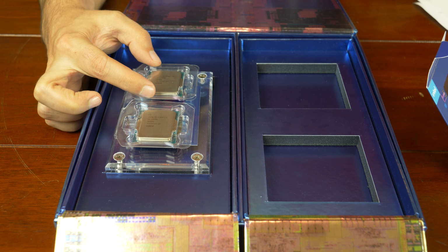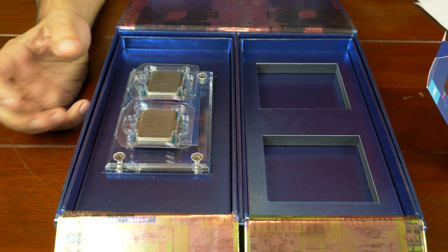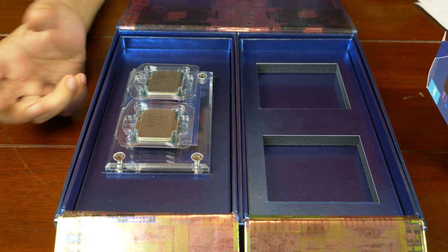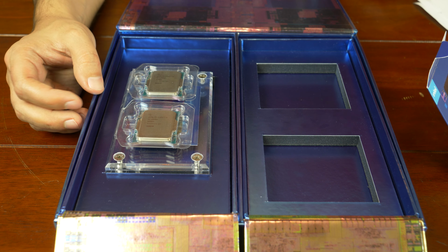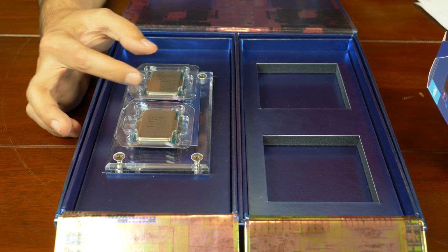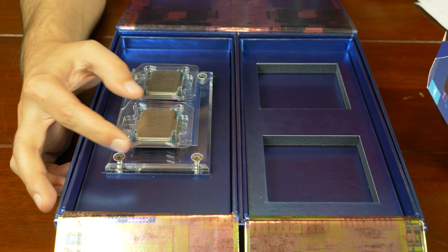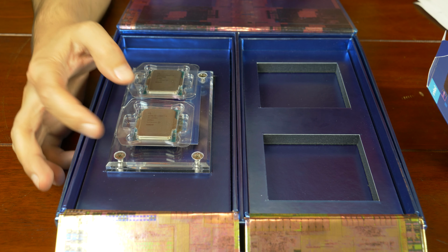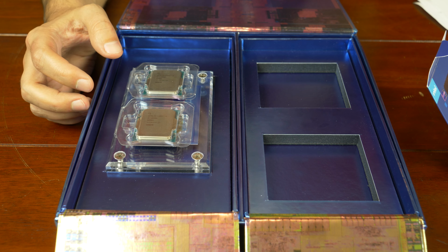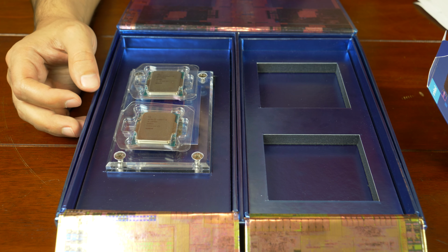Anyways, we have higher cache sizes. Starting here, we have 36 megabytes of Smart Cache, which is basically L3 cache with enhanced prefetchers, and the cache is smarter. Anyways, it's 36 megabytes here. On the 12900K, it was 30 megabytes. So you went from 30 and they added 6 megabytes of L3 here. This one is coming in at 24 megabytes of level 3 cache, or what they call last level cache, LLC. So 24, and that improves upon 20 megabytes. So you get 4 more megabytes here, and you get 6 more megabytes here.